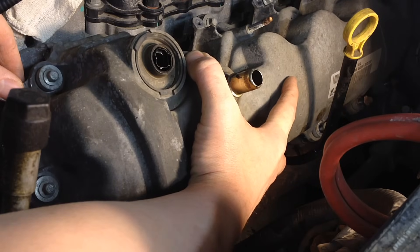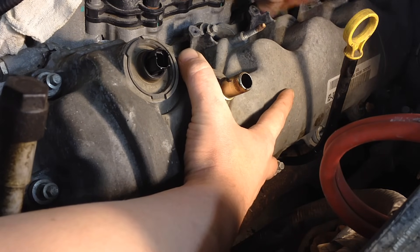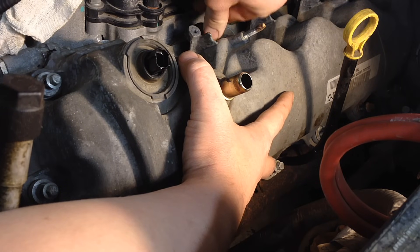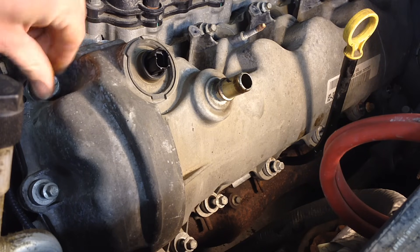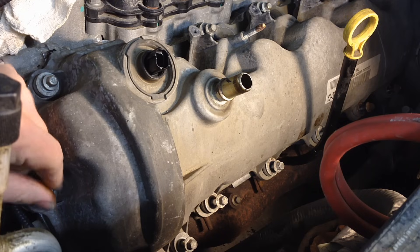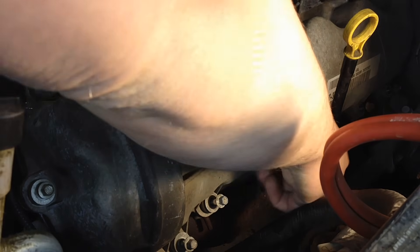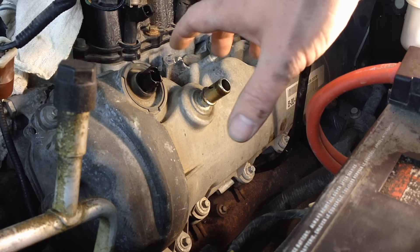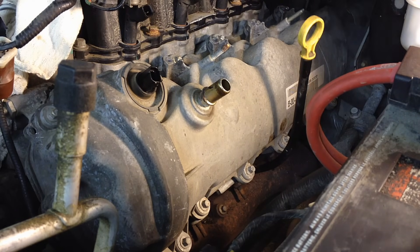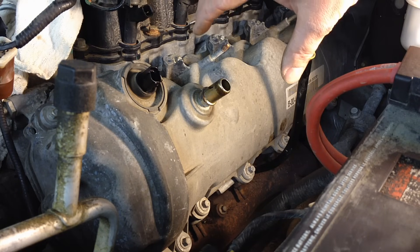The VCT solenoid will help you line up all the screws. Get your top screws in first — that will start lining up the bottom ones, which tend to hang over and get caught up. Go around and make sure they're all in, especially on the top and sides. Once all the bolts are threaded in by hand, jump around from the center out in a swirl pattern, going bigger and bigger, to snug them down and take up the excessive bolt length. Then do the actual torque sequence.